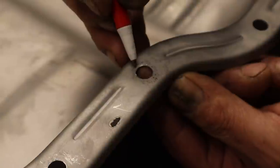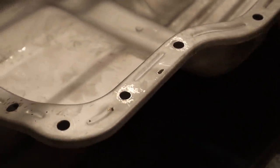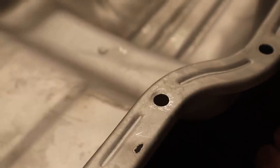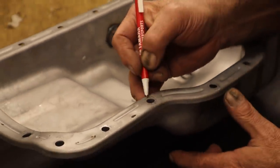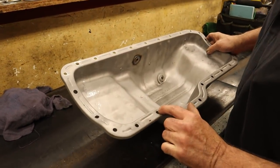But you can see it there. And there's a gasket that goes there, or RTV and a bolt. Would it have ever done anything? Not really. I was just impressed that you're training your eye to find cracks. That's important. I was amazed, like, you actually did find one. It's so small, and we weren't looking. I've never seen a crack with a pan like that. But sure enough, it's a real crack. So we're going to go ahead and weld that as well.